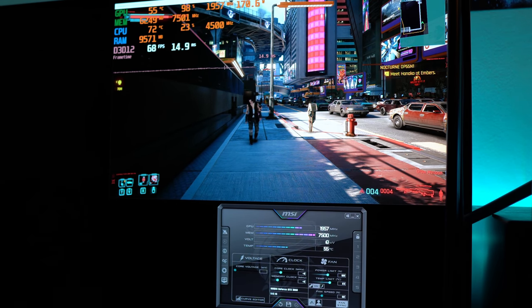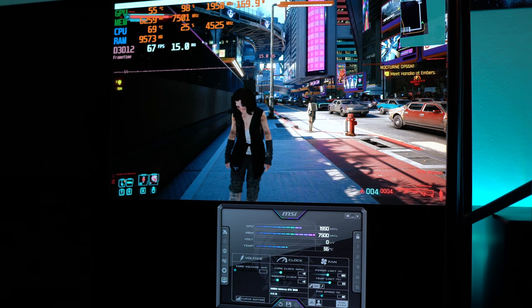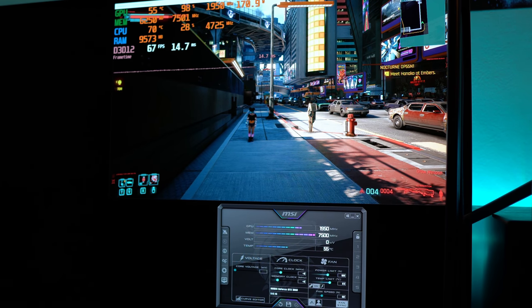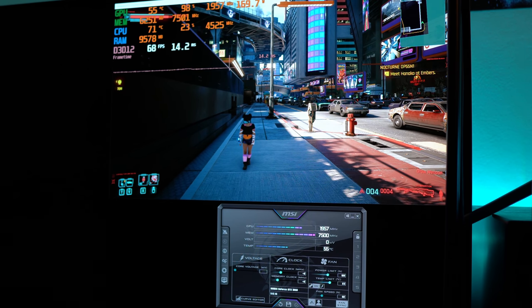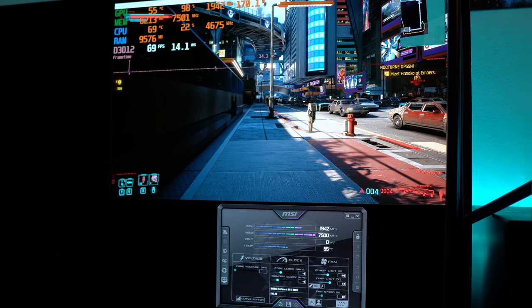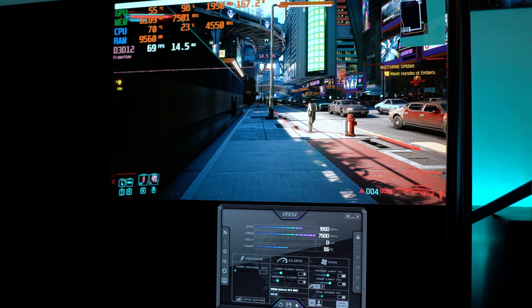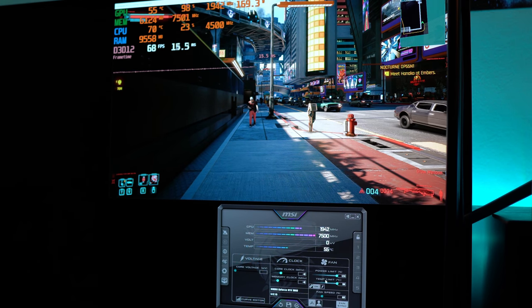What I'd really like to see is how far we can go without worrying about the voltages. First, let's give it more power. Notice that I'm running something here — this happens to be Cyberpunk, but really just anything that's going to be demanding on your GPU. Once you've dialed in the overclock, you're going to want to run some sort of benchmark and stress test it, make sure it's working. I like to have something where I can see if my performance is changing and whether it's stable. If it instantly crashes, that's bad. Lots of sparkles are bad — we don't want sparkles.